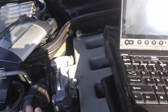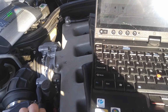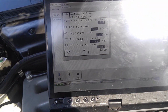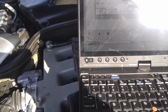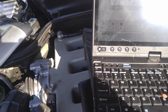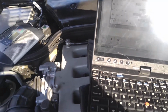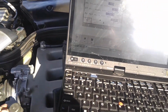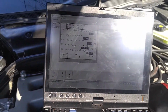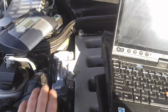So, knocking on it, no problem. So I'm gonna unplug it. Here I had it unplugged. As you can see, readout went away. Plug it back in. Come on, buddy. And the engine sort of chokes. That is proper. And I plug it back in, and you see the reading is there. Very nice. That's it. So definitely there were shorts in this circuit here, plus vacuum leak repair.